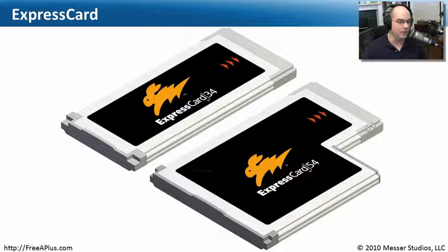The Express Card 54 fits into a larger slot, but where it actually plugs into the motherboard is still a very small interface on the inside — it just gives a little more real estate on the card to add more electronics for advanced functionality. If your laptop only provides an Express Card 34 slot, that's the only kind you can use — you can't plug in an Express Card 54. As newer laptops come out, you may need to upgrade your expansion cards to the Express Card format and not assume your old CardBus card will still work.